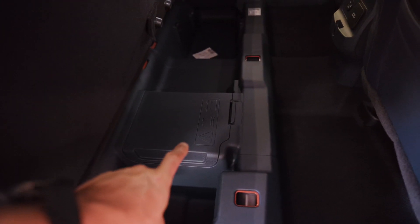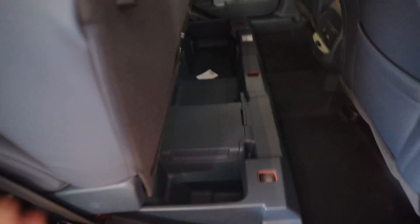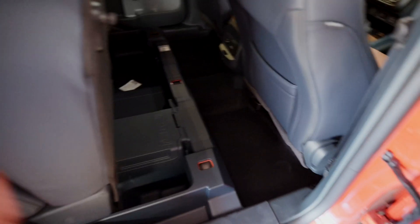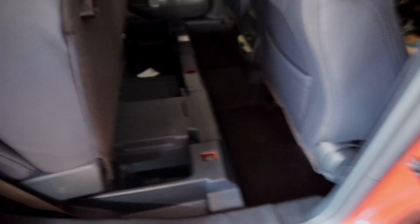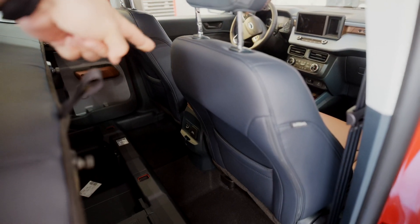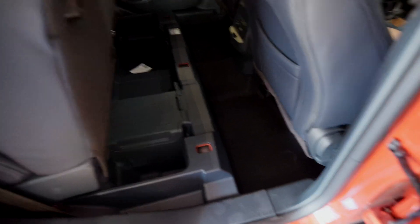Come around to this side and I'll show you the little battery pack that's responsible for all this fun. Right here underneath the seat, taking up a little bit of storage, is the area designated for the hybrid battery. There's still storage space on either side, but this little hump in the middle is taken up by the battery pack. I think it's a good trade-off for the mileage you get. One reason this placement is actually really clever is weight balance — most of us drive alone, so you've got your weight on the driver's seat and then this weight back here counteracting you in a diagonal action, balancing the vehicle as much as possible.